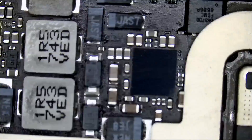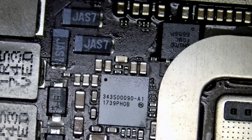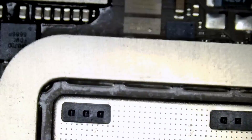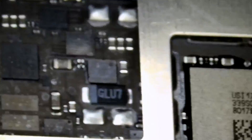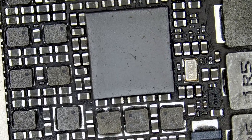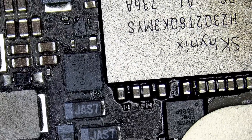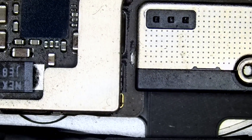Let's go under the microscope — that's the chip right there. This one is the 00090; we have a lot of those ICs in stock because we use them all the time. That's the battery connector, the Wi-Fi chip, FPC connectors for the screen. What we're going to do is take quick measurements in this area to see if we have a short circuit anywhere around this chip, because that's very common on iPads. If you look at the board you see a lot of flux everywhere — the flux is not from us, it came like this. All we did was go over the flex cable, which made the tablet go from a fail to a pass on the charging flex cable.